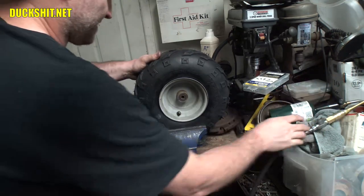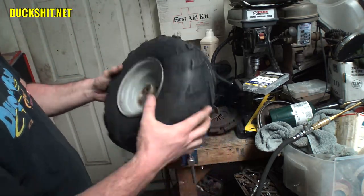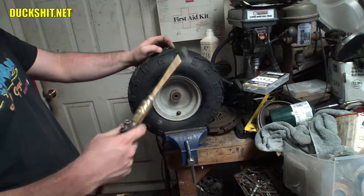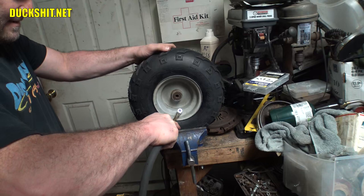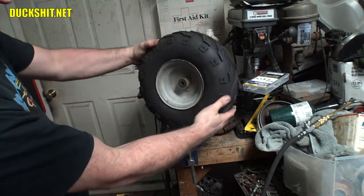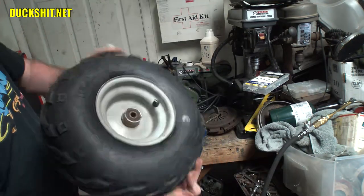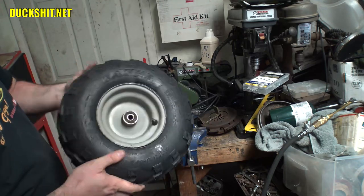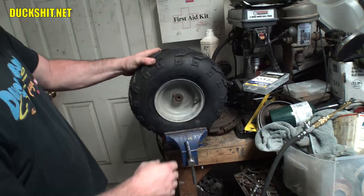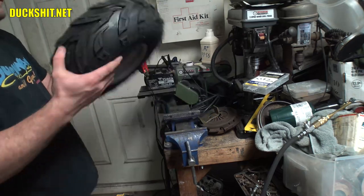Got it! Now these are only supposed to take about five PSI. I'm going to over-inflate it just a little because you want that bead to seat all the way around. It feels really flat — helps if I put that on straight, doesn't it. Five PSI is nothing; I tend to over-inflate these a little because I'm heavy. There it is — a wheel assembly with a brand new tire on the old rim. The bearings are going to need to be replaced. I might even paint the wheels, but I think they just need a good cleaning. I kind of like the Doodle Bastard's rough and tough look.